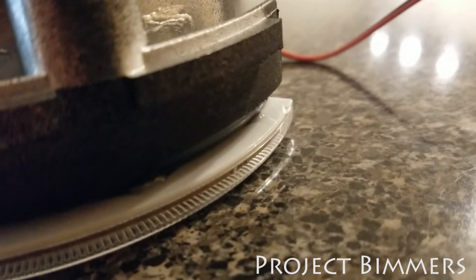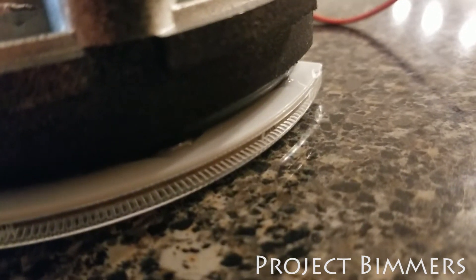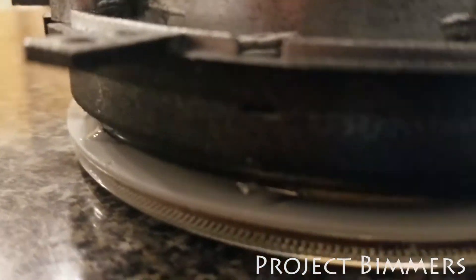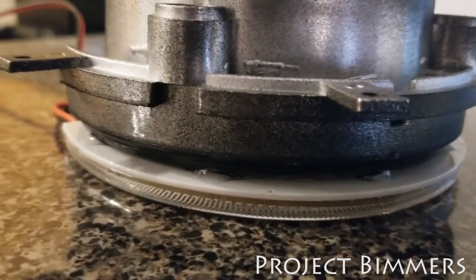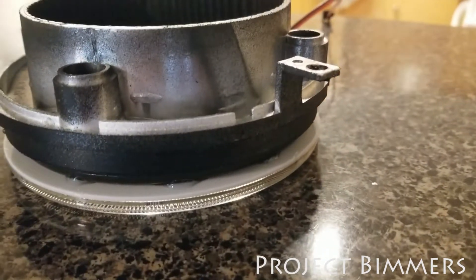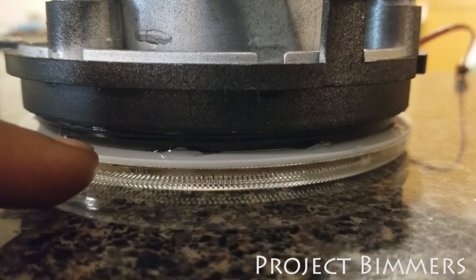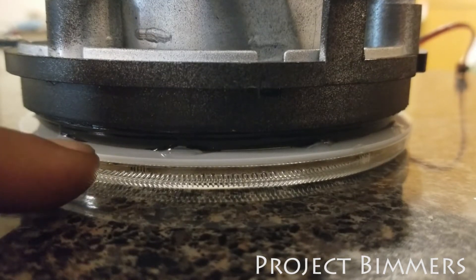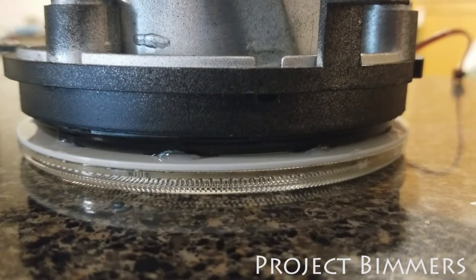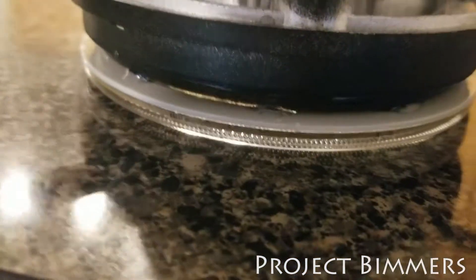That's done — I just flipped it over. That was the lip I was talking about. The new halo on the bottom — the black halo — you can't really see it because the housing's covering it, but you can see the glue, little dabs all around. I went all around putting a little drop of glue. Now that's going to dry and it'll hold solid — it'll never come off. That's super glue — Gorilla glue. But here's a trick: I glued the back — that white backing is actually removable. So if I ever needed to service the light, I could just remove the back, it'll stay attached to the black halo, I can change the LED board inside and still have the clear ring.